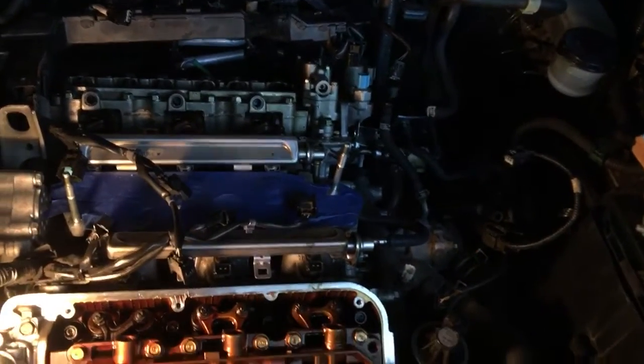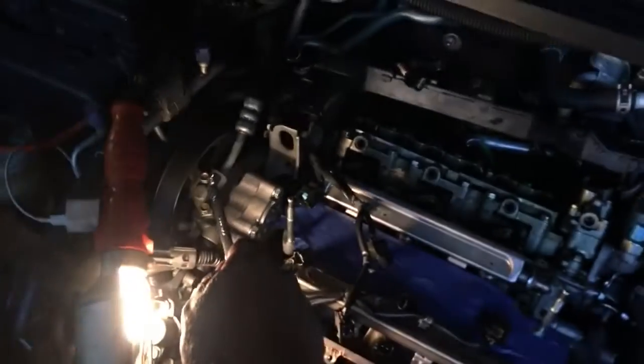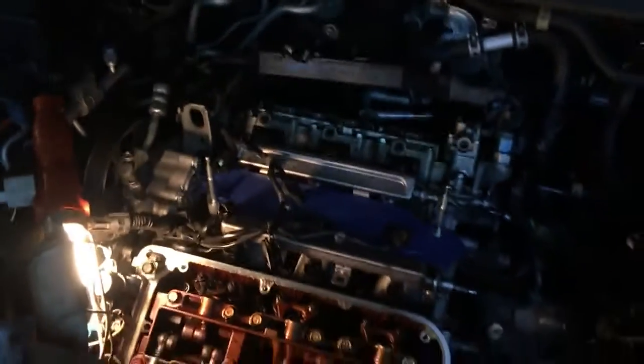First is the big air manifold that comes through. The rear valve cover, I know a lot of people complain about it being a pain and talk about removing the power steering fluid pump there. I was able to finagle it out, but I did loosen a lot of the different harness connections. There's some that you still can't quite remove. That big rear section right there goes.